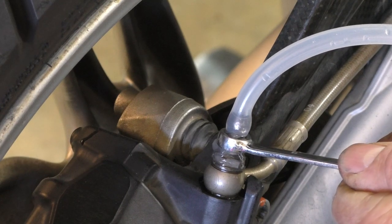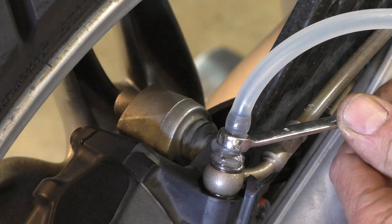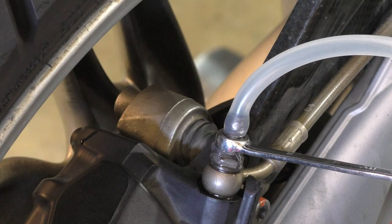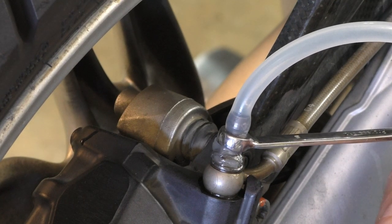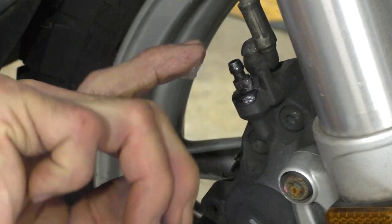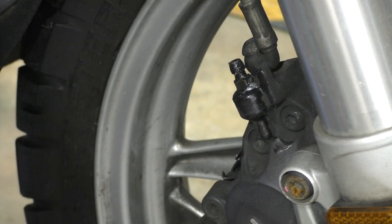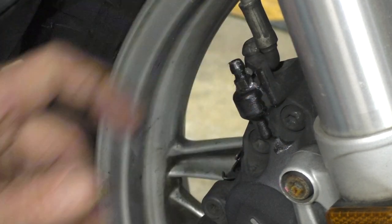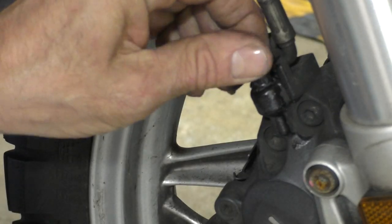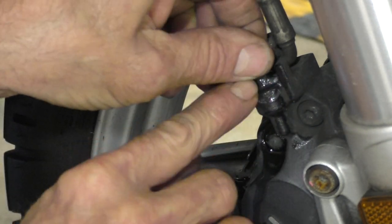Activate the pump, crack it open a little — we've got fluid. You can see there are no air bubbles now when I open and close it. So some of those air bubbles were coming from the base of the bleeder — that can fool you. Same thing on that front bleeder, a little bit of silicone grease. It's a little tricky to get it in behind there, but turning it a little helps.